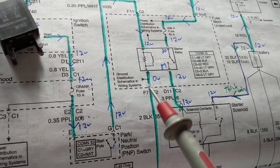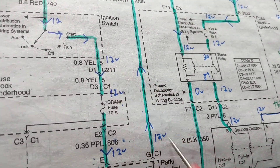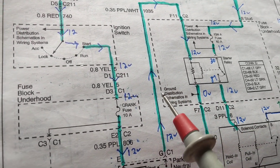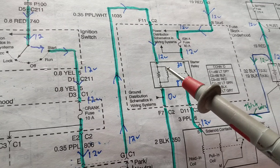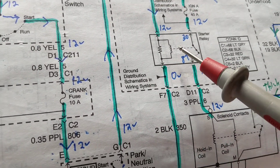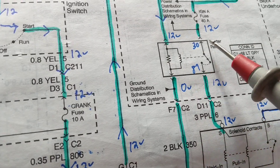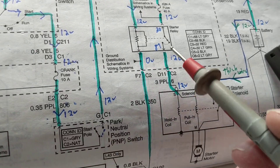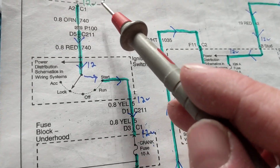We always start analysis and troubleshooting from this side. First of all, there's an ignition switch — in some vehicles today there is no ignition switch; Acuras and similar vehicles have a push button. The old style has an ignition switch. We're going to start here and get to this destination — this relay. This is the coil side with the resistor in parallel, called the control side. The other side is called the load side because it's connected to the load, which is the starter motor when the relay is closed.